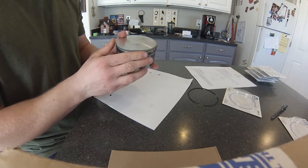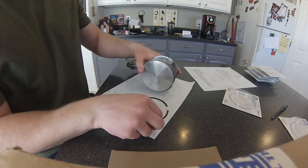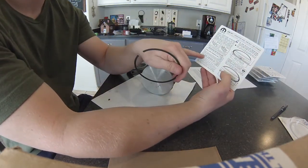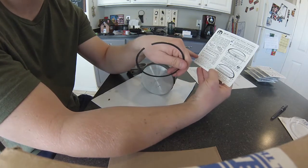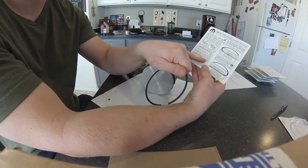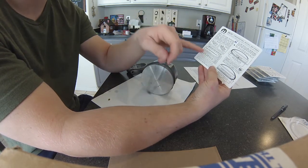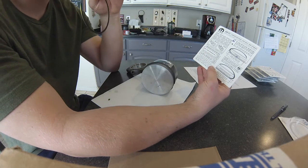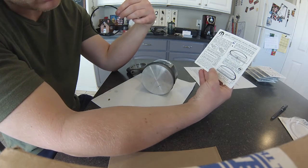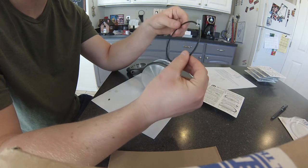The last ring — your top compression ring — is going to be towards this mark. According to Chrysler, or at least according to Mopar, it mentions this top groove compression ring. It shows this little groove, but this ring does not have that groove. According to the service manual, it shouldn't have that groove either, but it does say the top will be marked with an ID mark — and none of these six rings have any ID mark on them whatsoever.